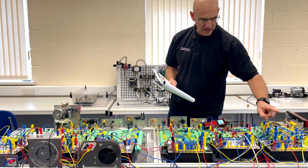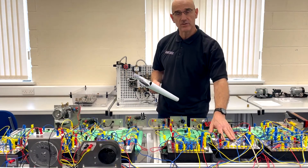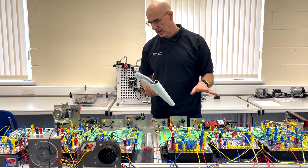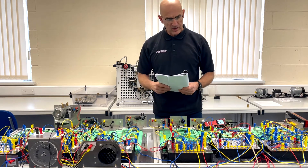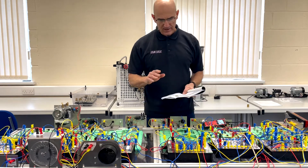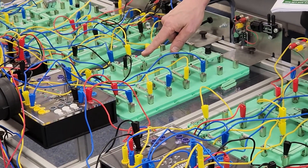The gateway, which is the main unit in the system, every few seconds interrogates each ECU to make sure it's still there. You can see that in that cycle it has detected that the rear ECU is no longer there, so a fault light has come on.